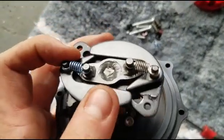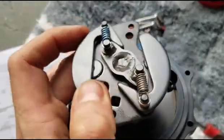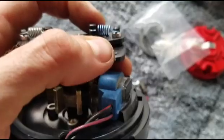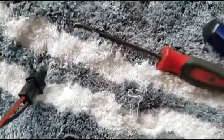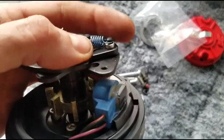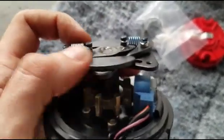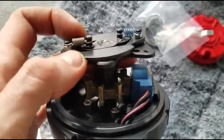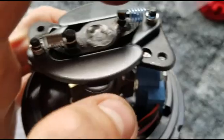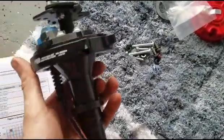I've taken out the two heavy springs and put in one light blue and one light silver. They move a lot easier now. When taking the springs out I used just a 90-degree pick. Don't lose the little spacer - make sure you keep that bushing. They come right off and just pop on right there on each end. It doesn't matter which way the spring goes or if blue is on this side or that. We're good to go to put this in the engine.